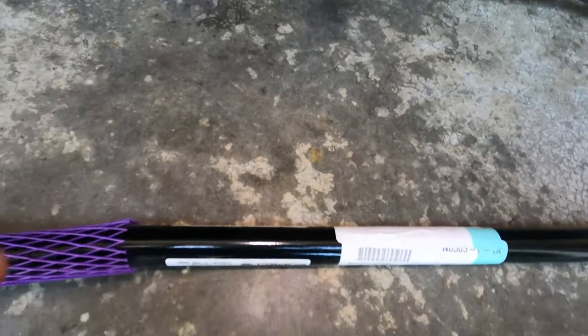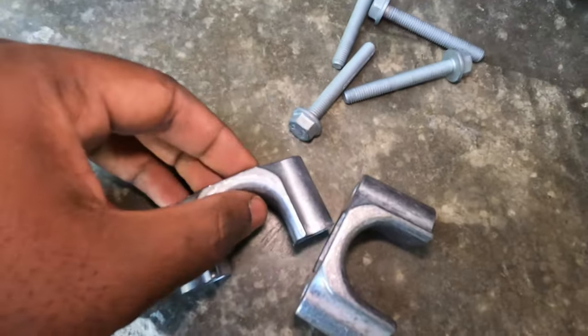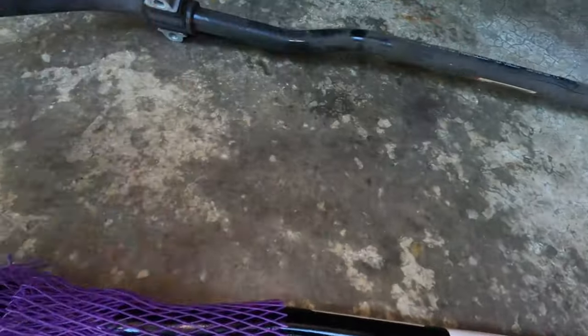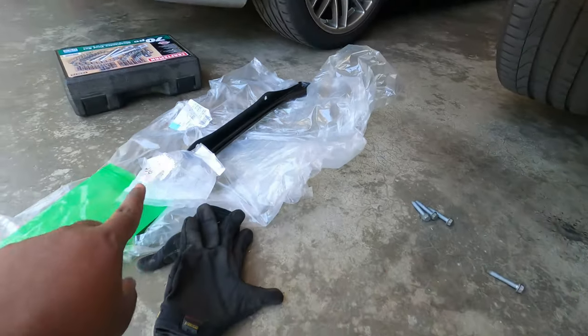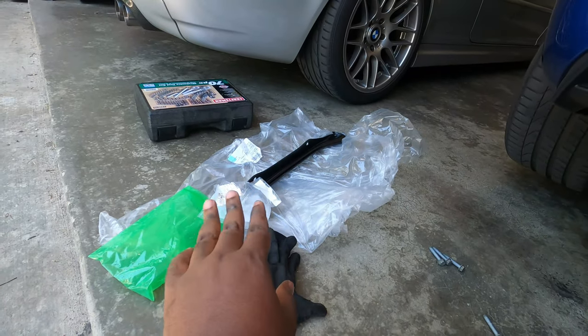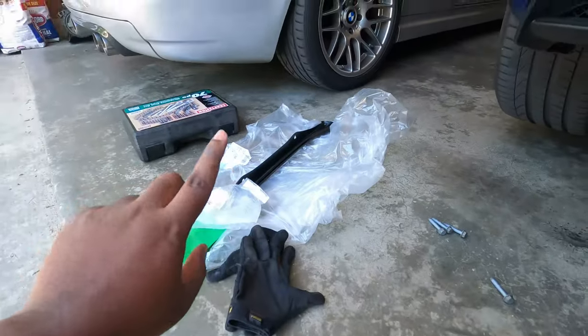That's how you know this is going to be way, way stiffer. Also, whenever you order this one from Porsche, they give you different parts - these screws and this bracket right here. These are the factory screws that came with this one; as you can see these ones are shorter. This one is much longer, so you will make sure that you use this screw whenever you are mounting that - especially if you are going to also mount that brace right there, because that actually came with it and you have to change the shape. The shape of this bracket is a little different. This one will fit much better with the bracket stiffness brace right there. But if you don't have to install the brace, then you don't have to have these screws.